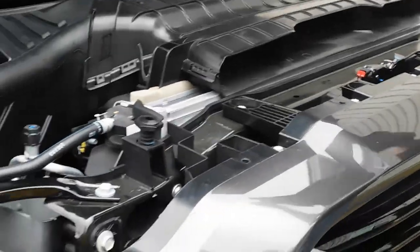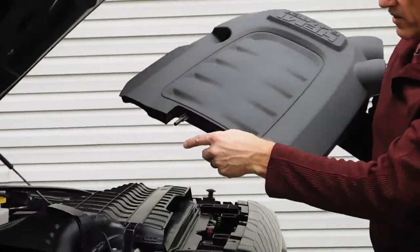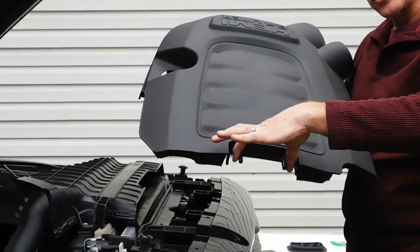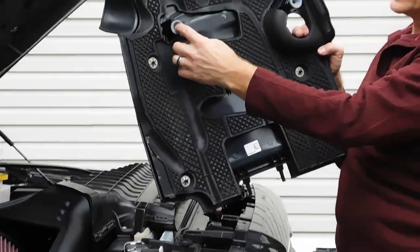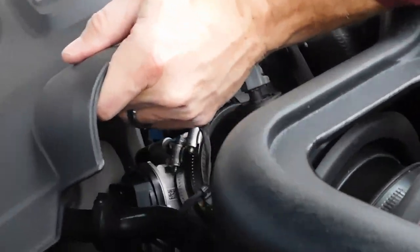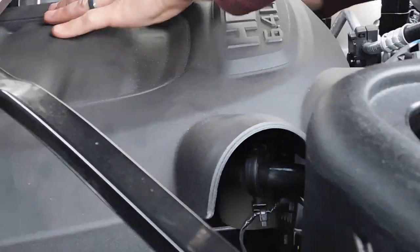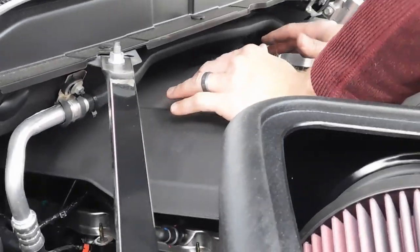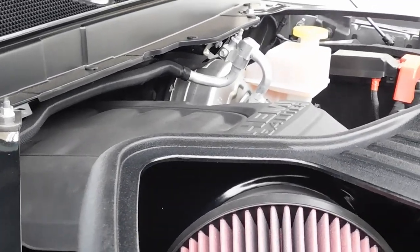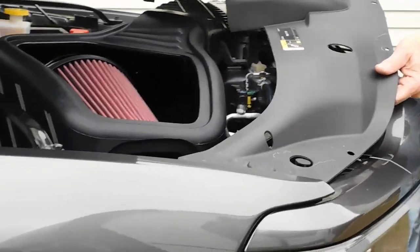Put the wire clamp back around that tube — lock that in. It keeps the wire from chafing on anything in the engine compartment. Route it behind this tube to keep it out of the way. Double check to make sure nothing's loose down in there. Everything looks good. Now reinstall the engine cover. It's reversed from what it was before — there are two little tubes that go into grommets inside. Tilt it up, slide it back into those grommets, then drop it down — it snaps into the clips and that's what holds it all together.